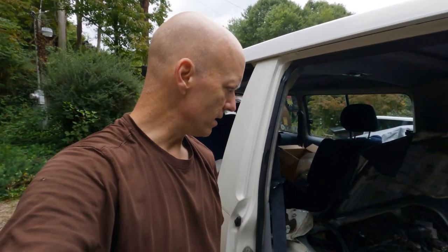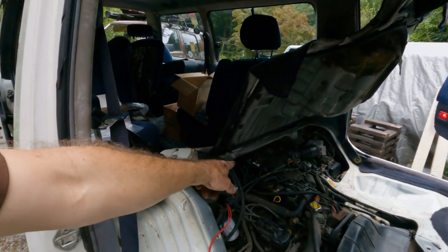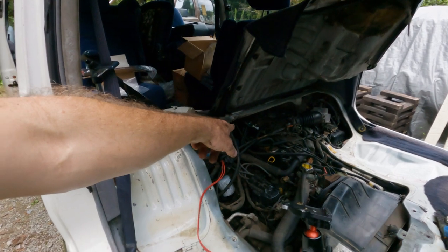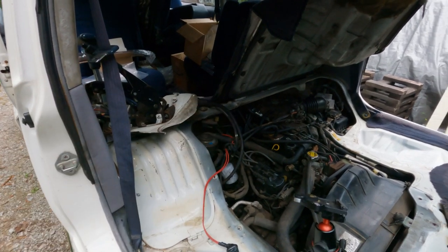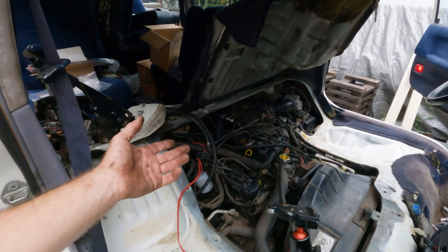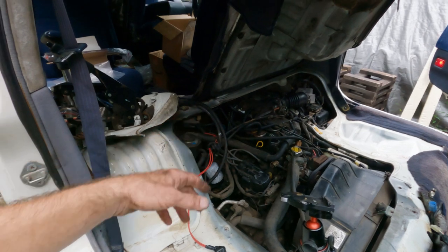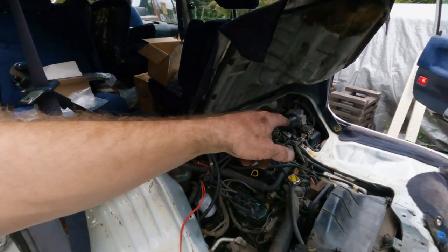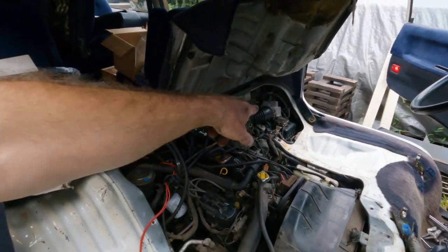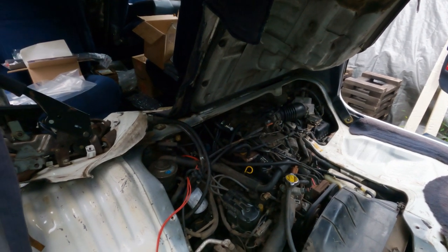The simple fact of switching those vacuum lines out, getting a couple of new pieces in, the diaphragm and the valve on the crankcase, having that replaced, and just getting rid of those old petrified rubber lines, getting those out of there and getting this fresh, that was perfect. Earlier I got the new air filter in place over there, so that made a huge difference.